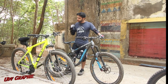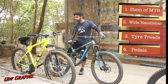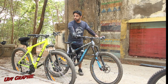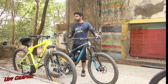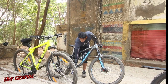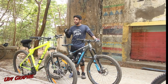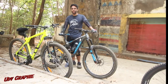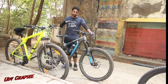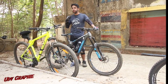So those three bits. And lastly, I'd recommend getting a good set of pedals. Pedals and shoes are your contact points — your shoes and handlebars with your arms are the two places you're always touching the bike. Just make sure you have pedals with a good amount of grip screws sticking out. It'll be horrible when they dig into your shin, but if you have good shoes it locks in nicely and gives you a lot of grip.